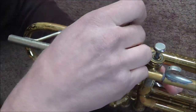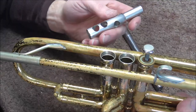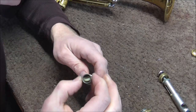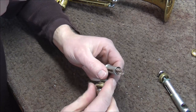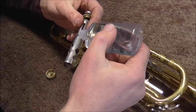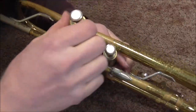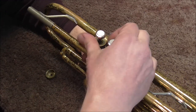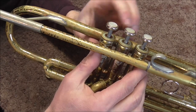The valve just drops right through, so I think it is fixed. I'm going to put everything back together and see if it still works. Valve guides only go in one direction — if it does not fit one direction, turn it around and try the other direction; it will probably go in that way. A little bit of oil, and the valve goes in just fine. The valve works now, so it is fixed.